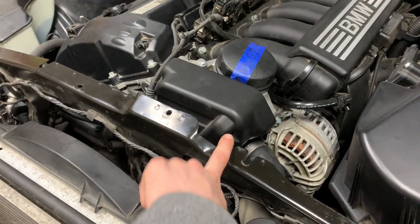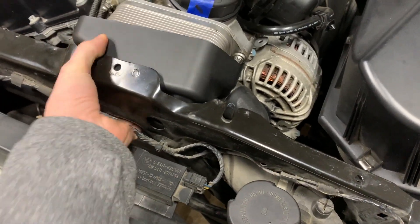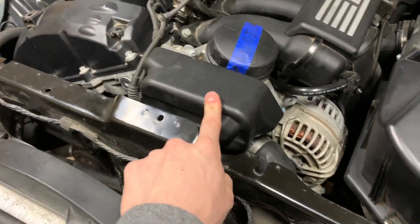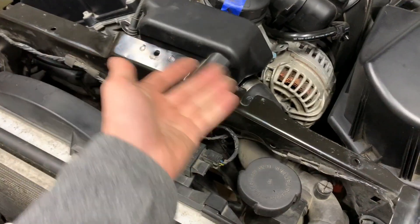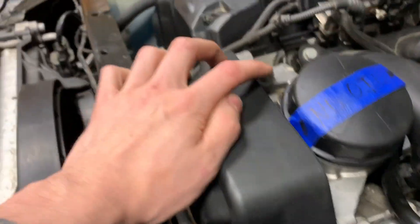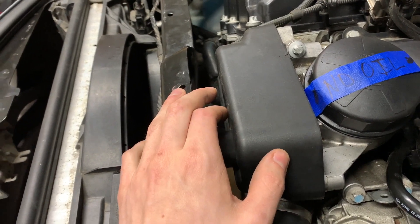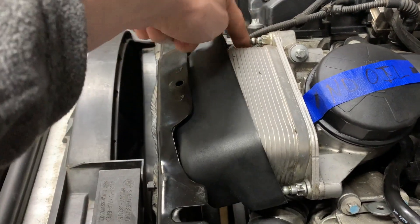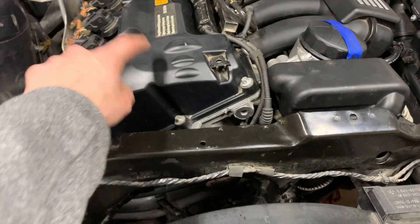Here's the only tricky part, and this is the kind of lazy lack of planning I've only seen on American vehicles. This cover has no way of coming off. At the factory they raised the engine up from the bottom and bolted it in place, but there's no room to get this thing off. I'm going to remove the three bolts and try to push or pull it to wiggle it off, but I can't even get a socket in there — there's not enough room. That's the first and really only design flaw I've encountered with this car, well, other than the camshaft issue.